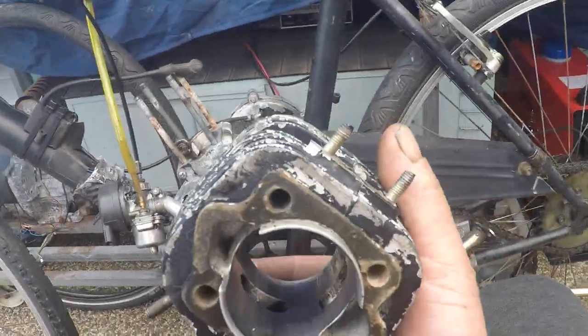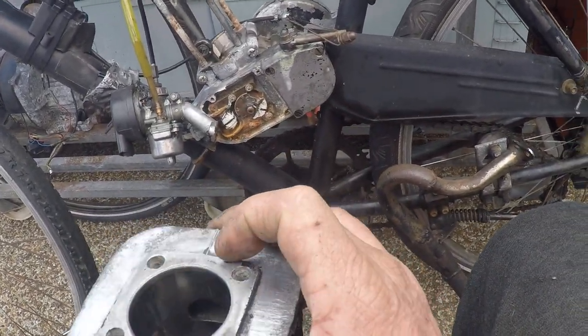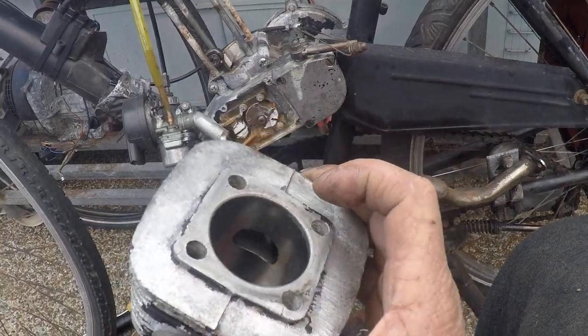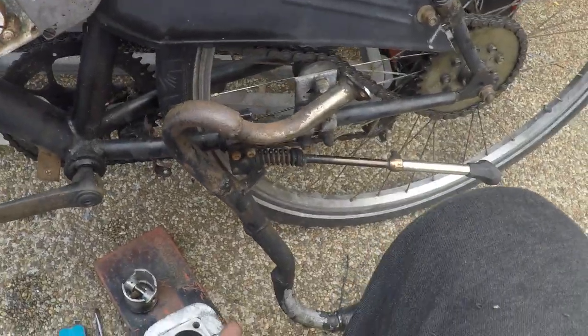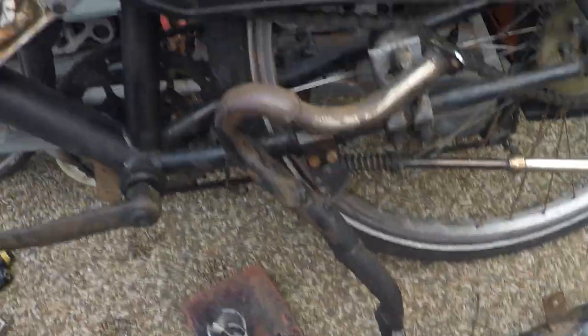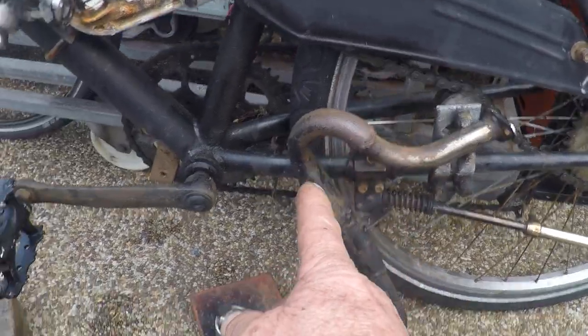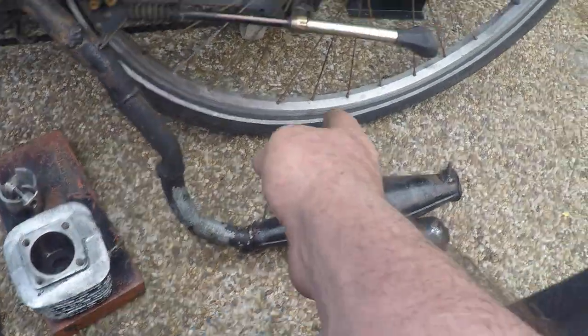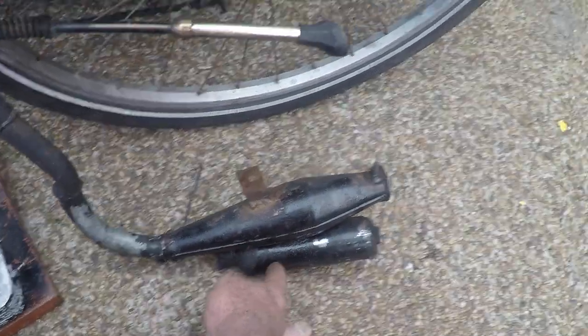Well, sideways port a little bit, you know. I did go up in the volume on that one, on the exhaust port, but try not to go too much. You've got to keep your compression. You want your pipe to work. That actually, even though it looks like junk, believe it or not, so that's thinner, fatter, reflection here, and the outlets here, which just runs down into the muffler.